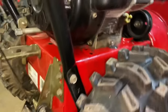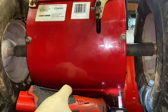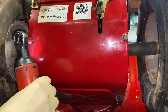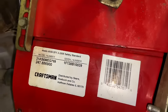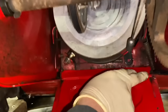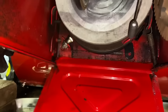Come under the machine — we just have a pan underneath here to get to that guide bolt. Back in the day they had six of these bolts; this one has four. Now sometimes this pan can get a little tricky to get off. It has a lip, so you have to wiggle it out and then pull it down. There's a little spring tension on it, and it has a little slit in the back that it goes up into. When you put it back in, make sure those two little grooves in the back go up into the slot correctly.